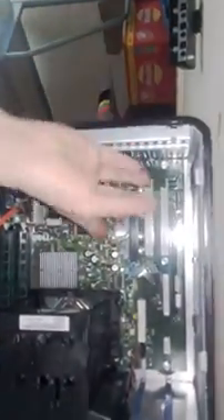You've got this port here, which is what we're going to be using today. But first we'll have to disconnect this part here — this piece here. It's a lot easier when you have no door on as well. Then you would have one of these slides here that you would have to take off as well. As you can see I've already done that. And then you would have your graphics card, which you would have to put in this slot here.